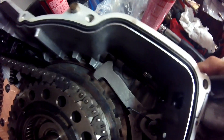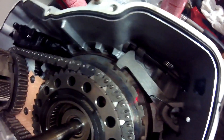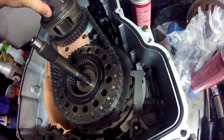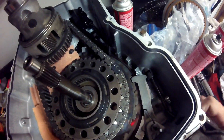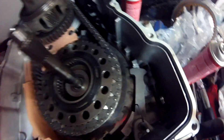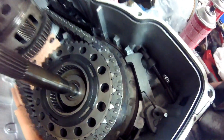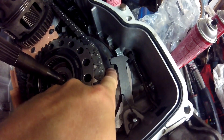You see, this moves the lever right there. Now we see that it engages in the tooth right there that holds all the gearing, which holds your axles still. Now whenever you put it in park and it's not lined up with one of these teeth, that pushes, and then when you take your foot off the brake your car rolls a little bit — clunk — then it goes in.